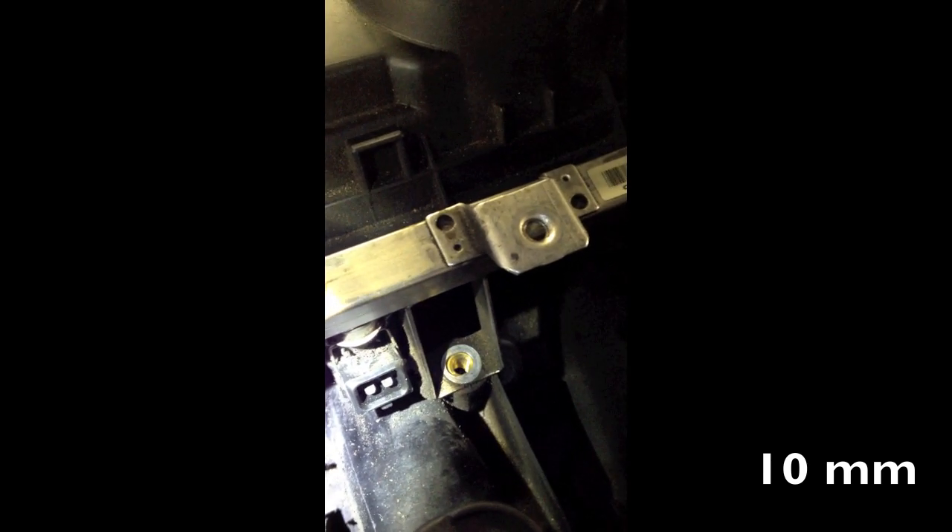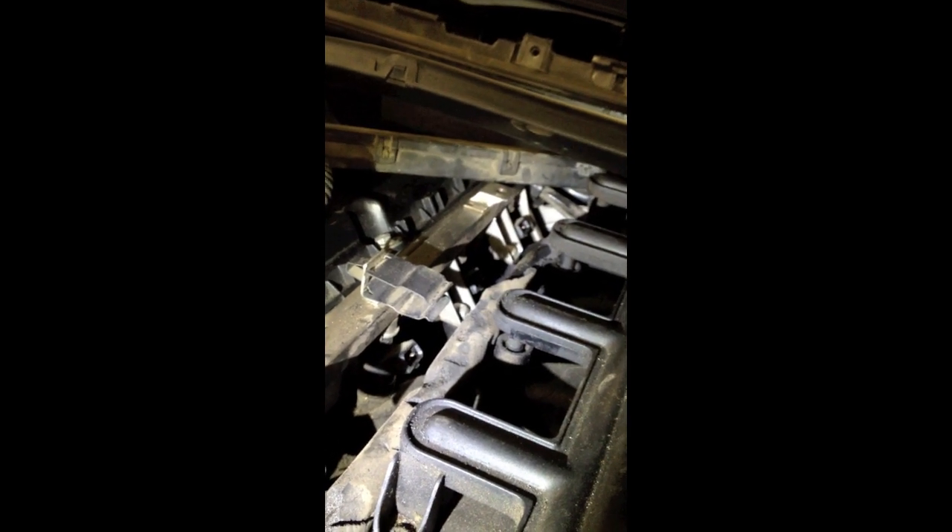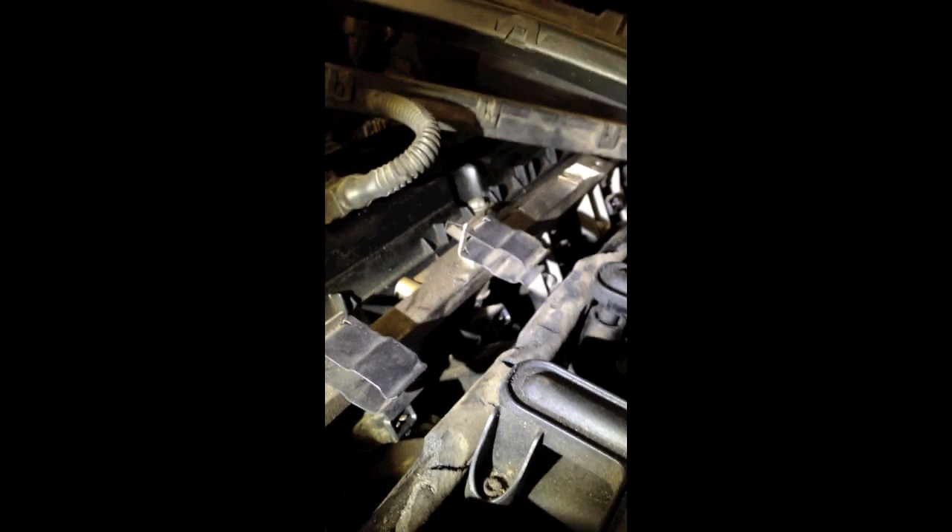Now I'm going to get these rail bolts out. You can see one, two, three — I already took one out, and there's one right there already taken out. So I have four more to take out. Once I take this thing off, in the back of the engine there's a quick-release fuel line, so I'm going to snap that out and get these fuel injectors out. It'll be a few more minutes — this is the middle of the project.